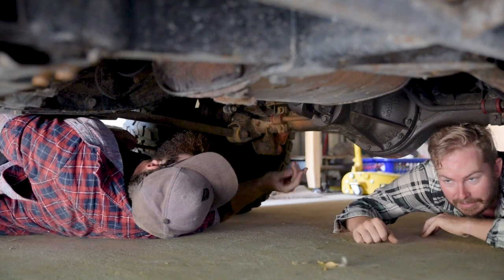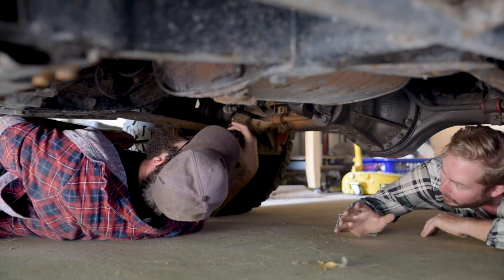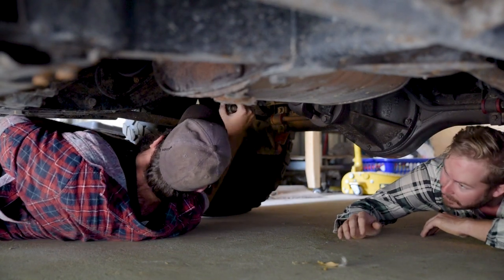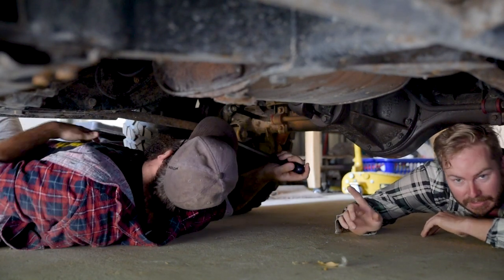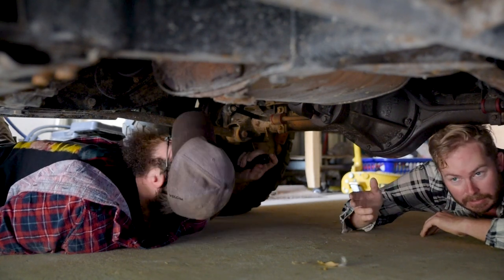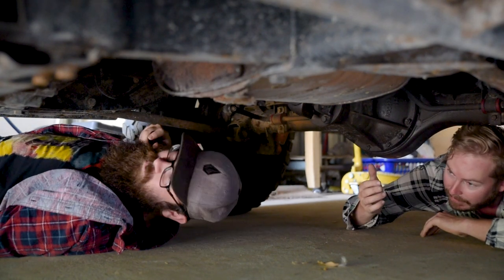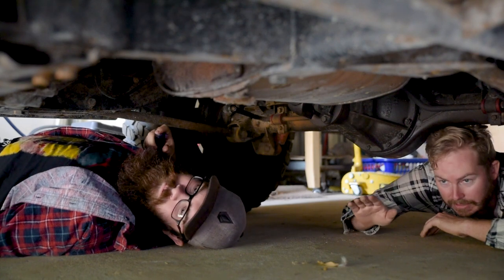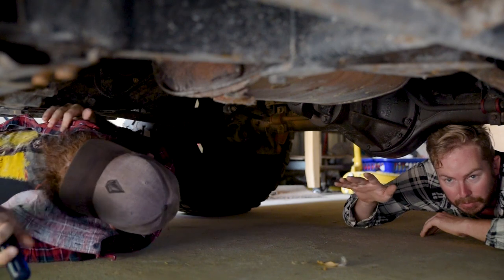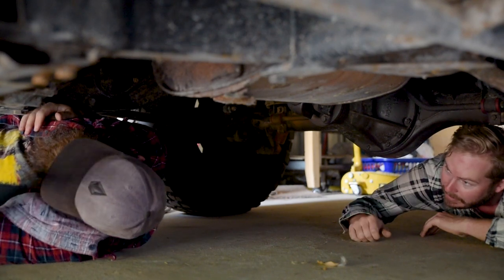What Taylor's doing here is having a bit of a shuffle around all the bushings, checking any loose nuts and bolts. We haven't washed underneath here yet, and the reason for that is because the light coating of dirt — if there is anything loose, loose nuts or bolts, it's going to leave a bit of a scrape where the part has jiggled around, making it a little bit easier to identify.